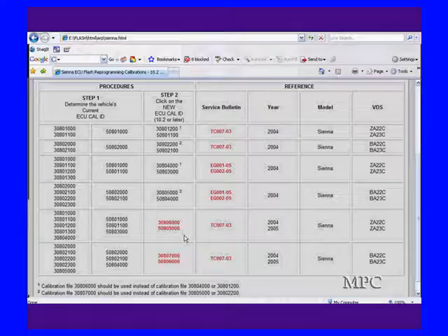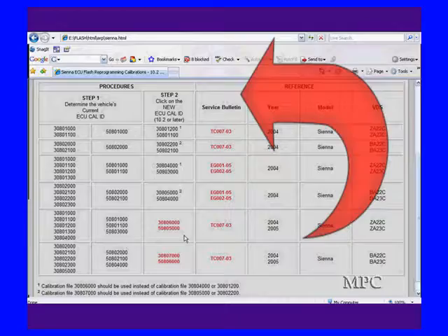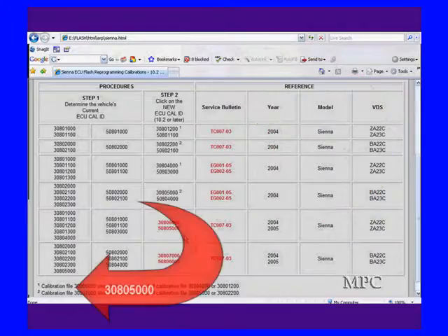The code here is: if it's black, it's going to go somewhere else. The red ones are the ones you'll update. There are technical service bulletins, and technical service bulletins are important for you to read and understand. Know what you're updating — are you changing idle speed or shift points? You need to know that.